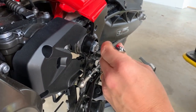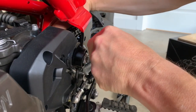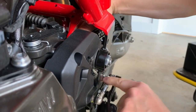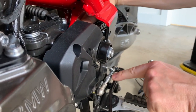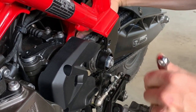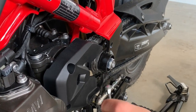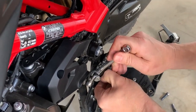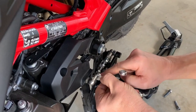You've got to just try and get an angle on it without damaging the paint on the lever, and get that nut loose — which I have done. Push away, spin it off. Get it to about halfway. That middle nut there is solid — it's fixed, there's no thread, it's actually welded in place. Same for the one at the front. I'll take the open-ended spanner off, pull it back out, get to this one with the lever, push it away to loosen it, and spin it off.